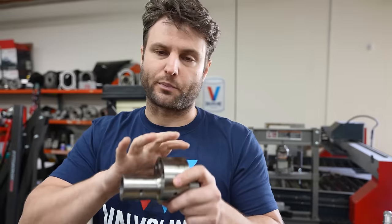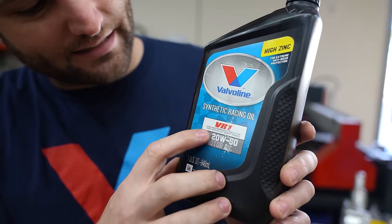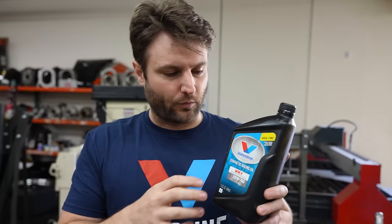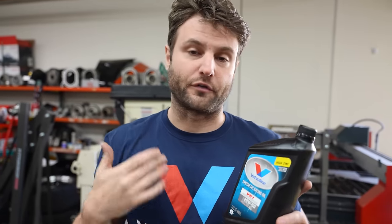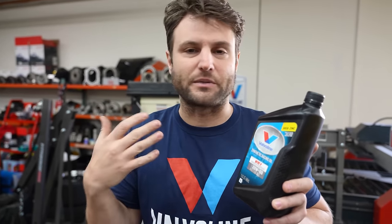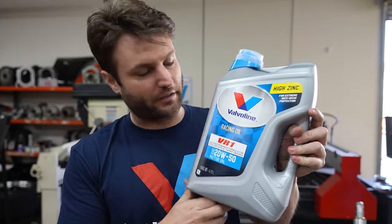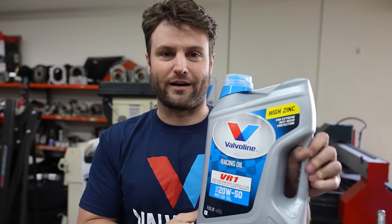Both products have the same ZDDP formula — about 1,300 to 1,400 parts per million of zinc and phosphorus, which is notoriously needed for rotary engines at these power levels. That softer metal really comes in handy to protect this engine. You normally need two things: the fluid itself and also pressure — and we've been struggling with getting and maintaining oil pressure in this engine. This product says 'for push rods and flat tappets' — I have neither of those — but it clearly works for more than just that. There are rotary guys still stuck in the old school mentality that synthetics aren't good for rotaries. The fact is they're wonderful for rotaries — they're not good for the oil metering pump. Mazda compromised on the stock engine design by adding crankcase oil into the combustion chamber; if you're making tons of power and want reliability, don't do that — premix instead.